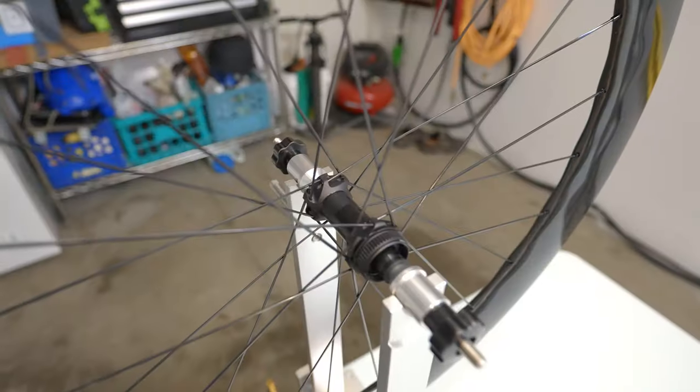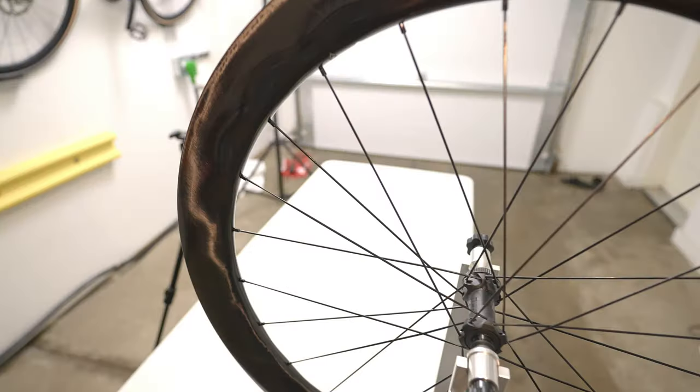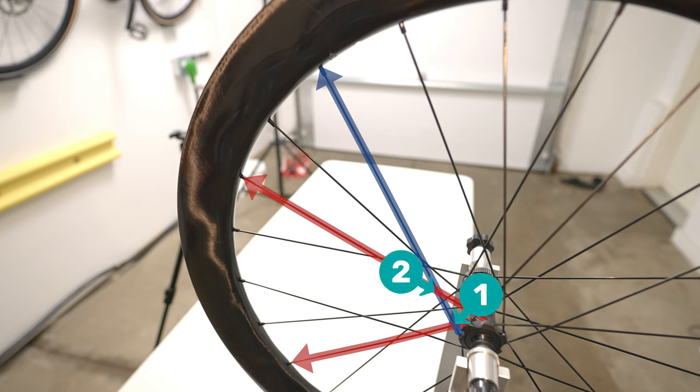This is the first time I used straight pull spokes on a wheel build and I gotta say I liked it quite a bit. I just find that it gives the wheel a very clean and custom look. Because you have to use the lacing pattern the hub was designed for, it makes it almost impossible to make a mistake when lacing up the wheels and they lace up really quickly. The DT Swiss 180 hubs are designed for a two cross lacing pattern on both sides of the wheel, so each spoke crosses the adjacent spoke at two points, hence the name two cross. Also, because of the spoke design, de-stressing a wheel with straight pull spokes is not as necessary as when using j-bend spokes, so there's less chance of losing spoke tension on your first few rides. The major downside is that you are restricted in what lacing pattern you can use, and straight pull spokes are harder to find and a bit more expensive than j-bend spokes.